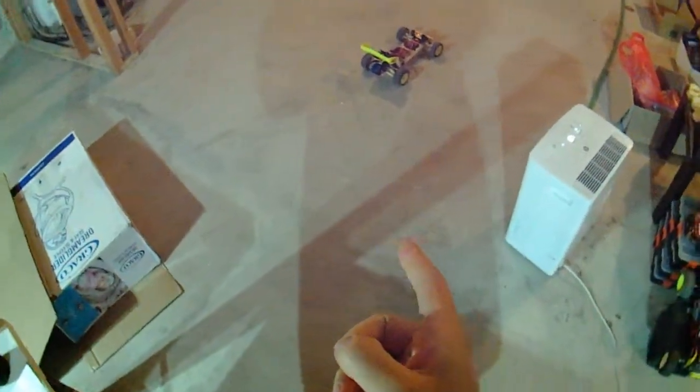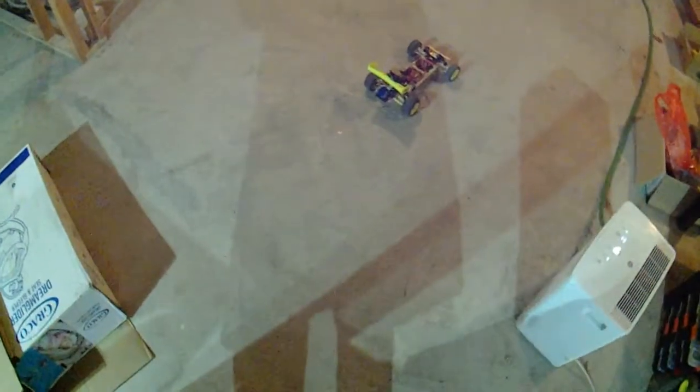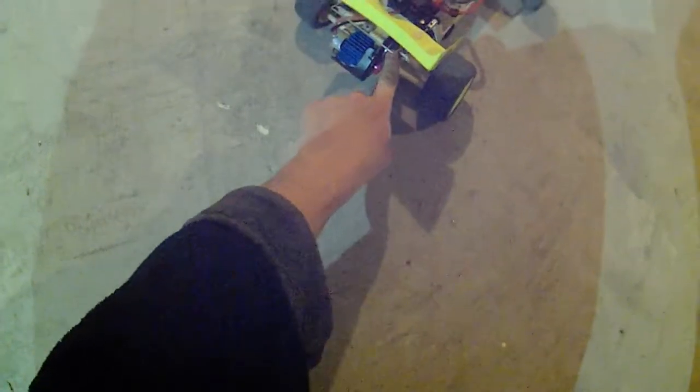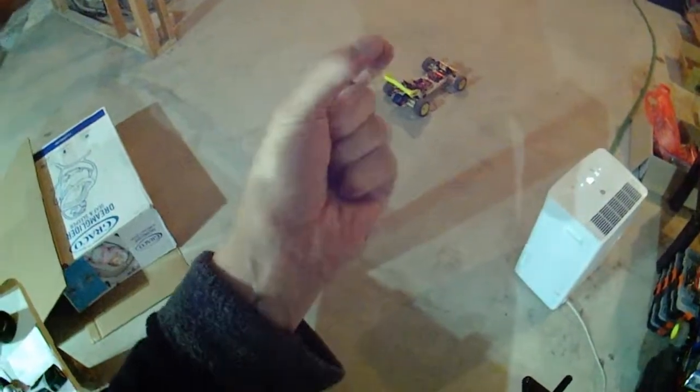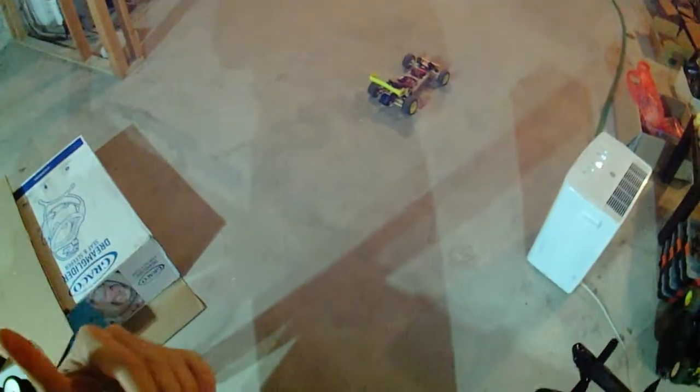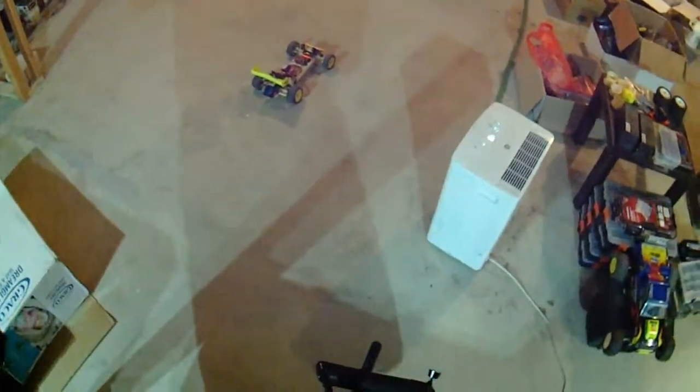So on this RC2, I did a few things to help the car go a bit quicker. I replaced the stock slipper clutch with an A&L hyper clutch, I think. And then I use these molded plastic pinion gears to get less rotational mass. The reason why I wanted to use this type of slipper clutch was because the stock Traxxas slipper clutch, with those little eraser-like pads, wasn't doing a very good job of giving me the right balance of slip and grip, if you will.